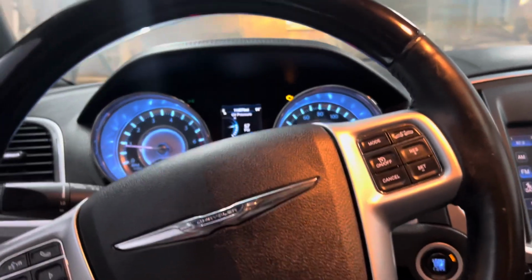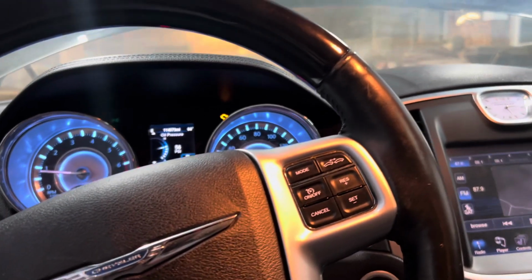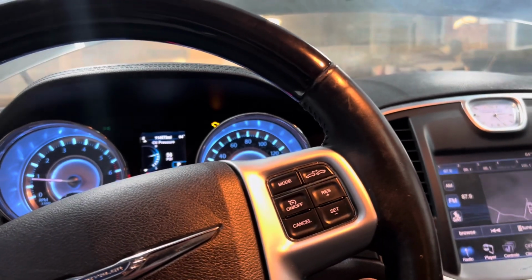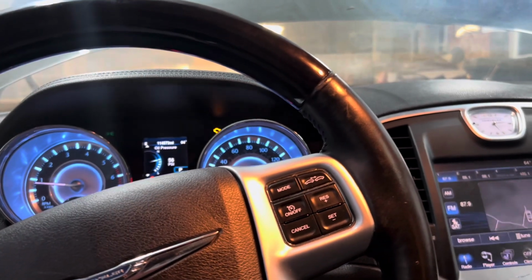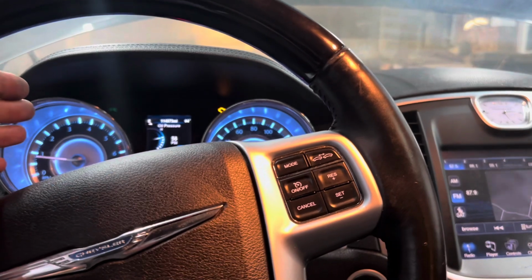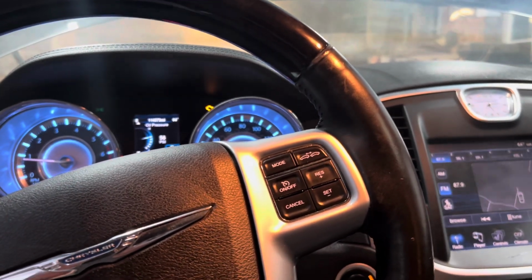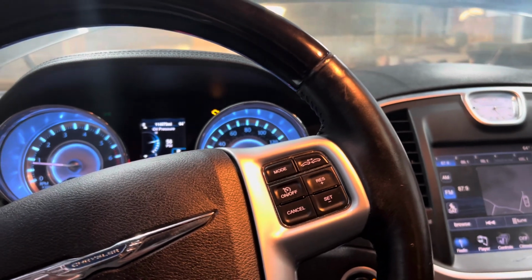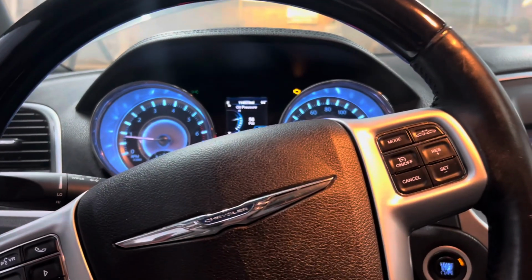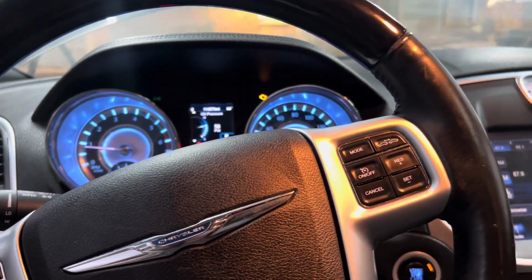All right, I got to apologize. I thought I was recording and I wasn't recording. I did my first start where I cranked it over for a while without the fuel pump relay in it. And then I started it and it didn't sound very good. It sounded really bad. Every single lifter was making noise like I expected it to because they weren't pumped up yet. And also I do have an exhaust leak that I kind of expected.